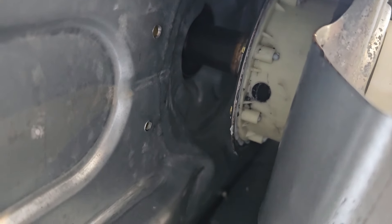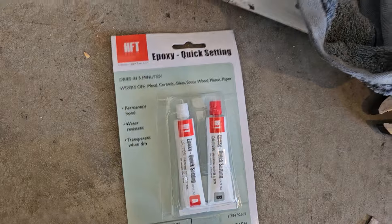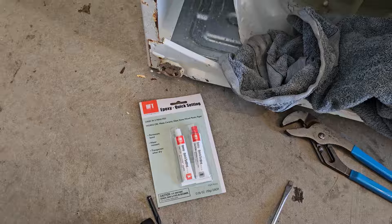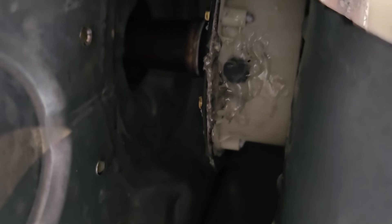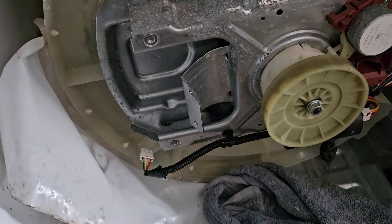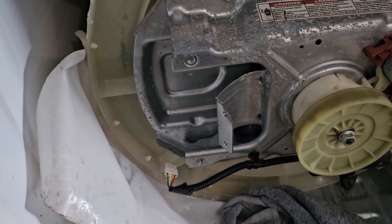We got a little bit of excess grease removed from the well and we're just going to seal it up. To seal it, I like to use this Harbor Freight version of JB Weld — their epoxy. It works really well. I'm sure hot glue would probably seal it too, but I don't anticipate the grease to spew out, and this epoxy works really well. I'm going to mix this up, slap it on there, and leave it alone for a couple of hours. I managed to get a big glob of epoxy on there and it sealed up really nicely — that is not going anywhere. The only thing left is to push this tab back into place and use a couple of sheet metal screws to hold it against the transmission. There's no real room to put new rivets in, so these screws will have to do the trick.